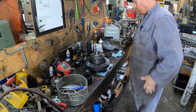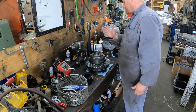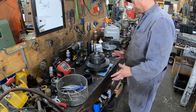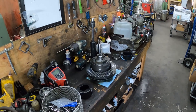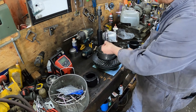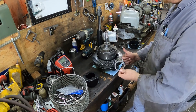All right guys, so you've seen that I just pulled that bearing off with this tool — super handy tool. If you're doing differential work you should definitely have one of these. There'll be a link in the description for it. Basically to make this simple: we're at 16 thou and I'd really like to end up at about 9 thou. So I am going to pull this shim off of this side — which is 6 thou — and that's going to shove the whole carrier towards the pinion. That will move the carrier over 6 thou.